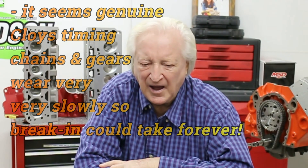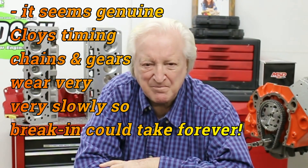When it came time to dyno the engine, it was down on power — I was missing at least 10 horsepower. It was making about 475 horsepower instead of about 485 to 488. After the dyno testing, when I pulled the engine apart, I noticed that the timing chain was still very tight, and it occurred to me that maybe that was the cause. So I loaded the engine back on the dyno, rechecked the horsepower, then took it down.